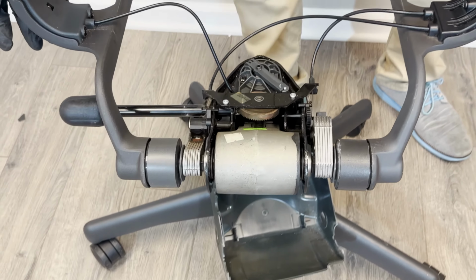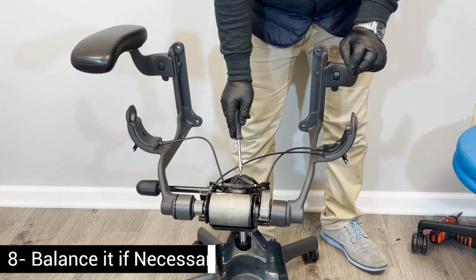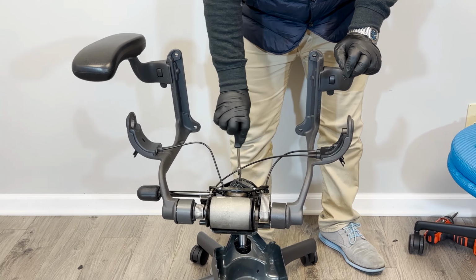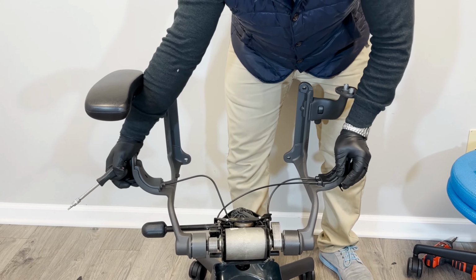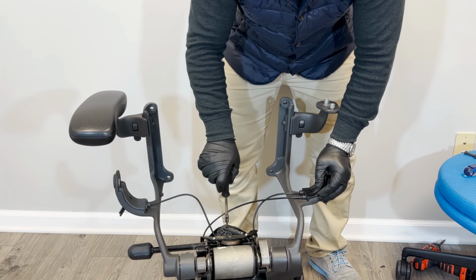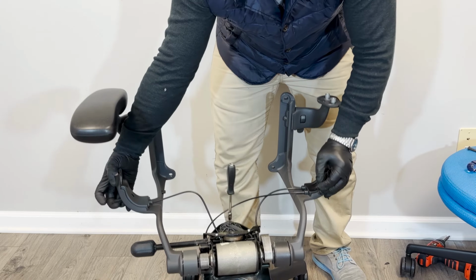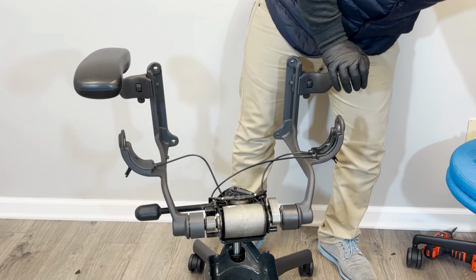You might notice your chair going up without touching the height adjustment knob. This means the pin on the mechanism needs to be balanced. It's a simple fix. Take a screwdriver and tighten the pin little by little, testing it with the height adjustment knob on the side as you go. Just be careful not to overdo it because you don't want to break anything. If it gets too tight, just rotate the pin to the other side until you reach a balanced state.